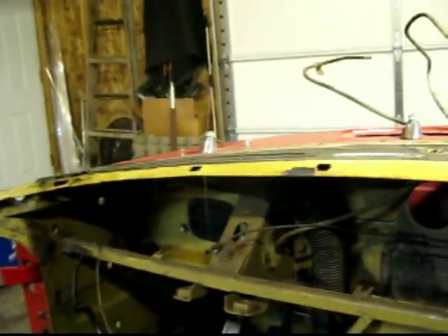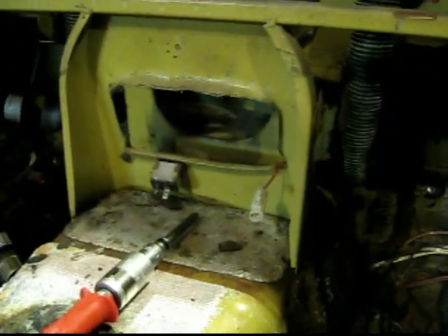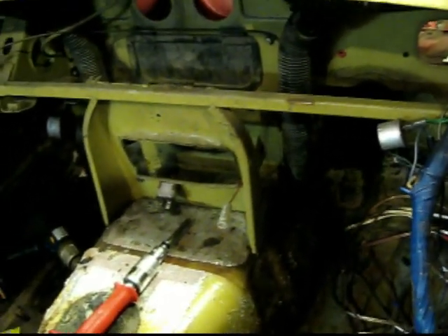So where the harness splits up here and goes down to what I'll call the rear harness, this part just feeds through the firewall right there, comes out the other side right behind the washer motor, and from there it goes over to the other side and connects to all our ignition and wiper switches and gauges. There's also a chunk that comes down right here — it goes to the radio, cigarette lighter, hazard switch, all that fun stuff. So that's the wiring harness.